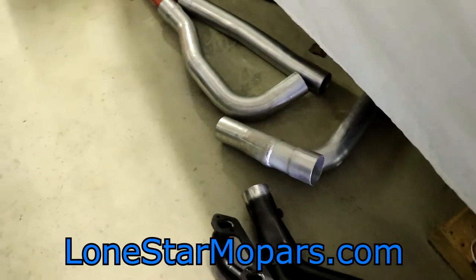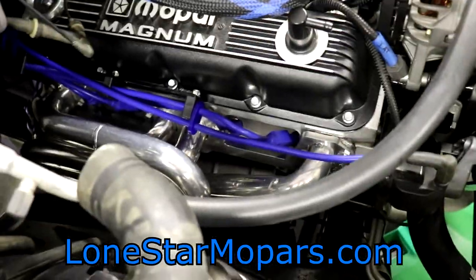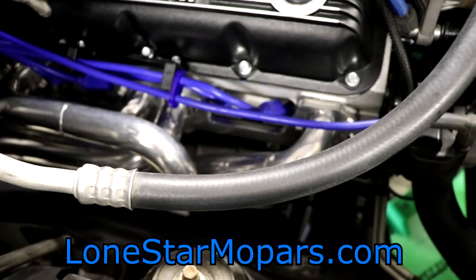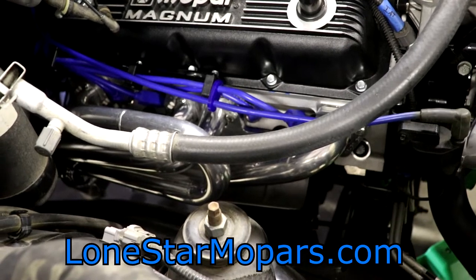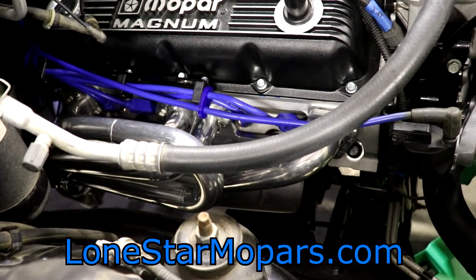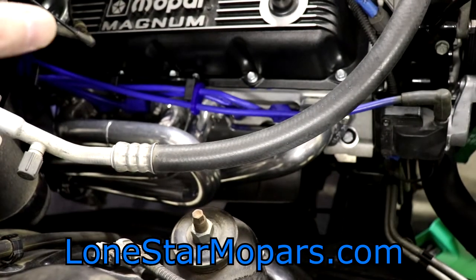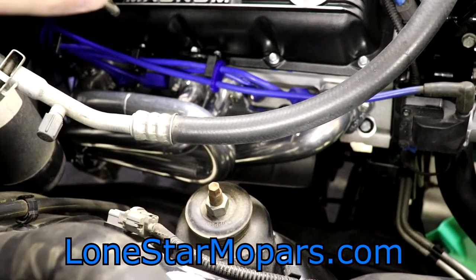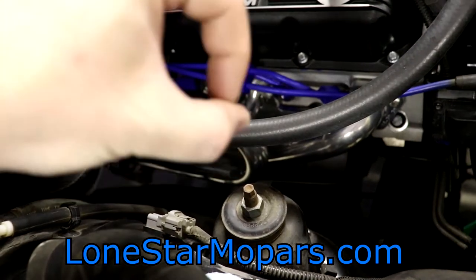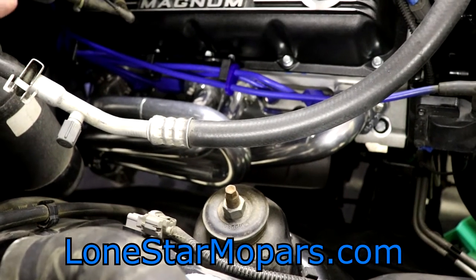Right there is the rest of the kit — the Y-pipe, everything like that. Up here we've got a super nice stainless ceramic coated Gibson shorty. I went with them because at the time I didn't think long tubes were going to be necessary, and I also didn't know that every single aftermarket option for the factory Y-pipe was anemically undersized. Literally, I can take my Y-pipe off this truck being an '01 and it will just engulf the aftermarket — and these are like Magnaflow stainless mandrel bent stuff. That was always the choke point, the weakest link in the exhaust. That's why guys go to yards and rob late model Rams to throw the Y-pipe on.